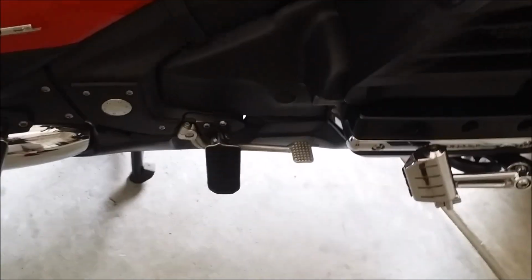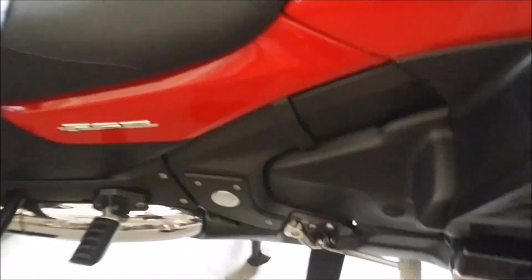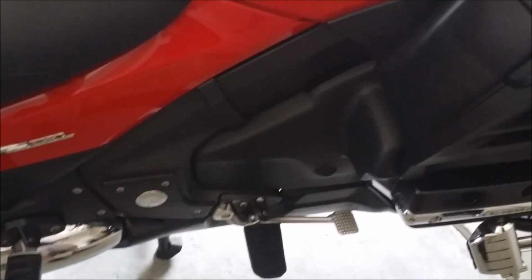So I think I'm going to play safe on my front caliper because this has got that linked brake system. So whatever you do, it affects things. Whenever you hit the front pedal, everything gets triggered, a little bit of back, a little bit of brake. Same with this brake pedal. Now, one thing this brake pedal triggers that the front doesn't, and we talked about this before, is the anti-dive, okay? I think you still get more back brake when you press that pedal, and that's when I really hear the squeak, on what on a normal motorcycle would be the back or pedal brake, okay?